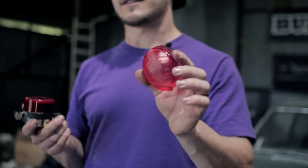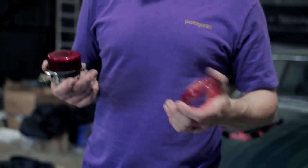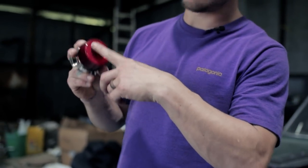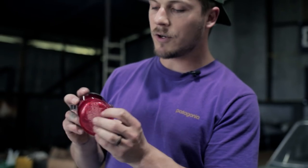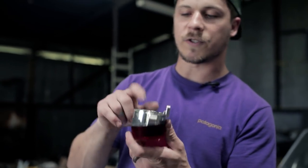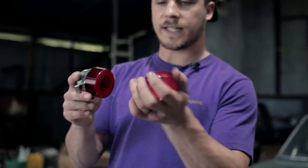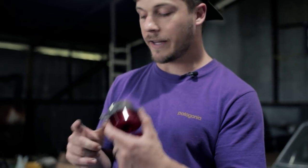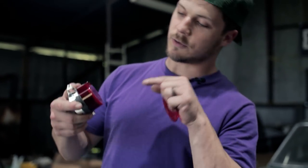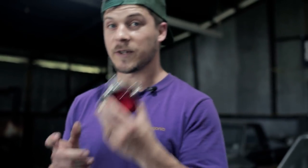And I wanted to make this a little more custom, and I wanted this to be like my son's version of one of his own cars, like all of my cars. So I got taillights that literally match the ones that are going on the MG, the Mirage style circle taillights, and they're almost the exact same size, and I was actually able to use the housing from the Power Wheels. So this housing was connected to this, we got rid of that, glued the light in, and now we have an LED running light that screws into the stock location and has a little Mirage effect in there. It's gonna look really, really rad and be so much cooler than this thing. Let's put these in first, and then we can throw the headlights in, and then we can put it all together.